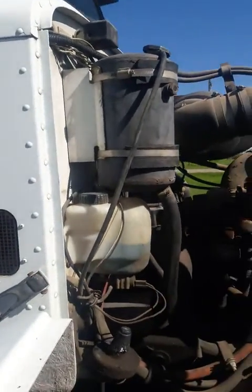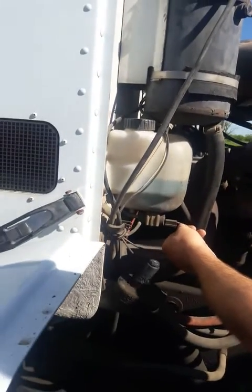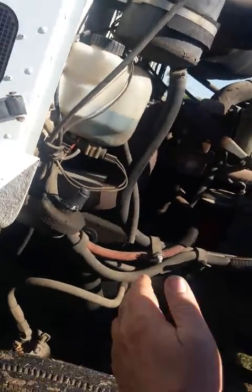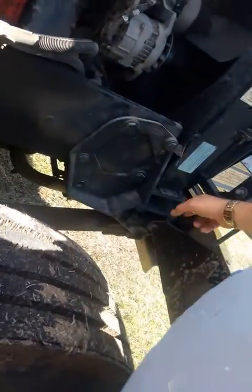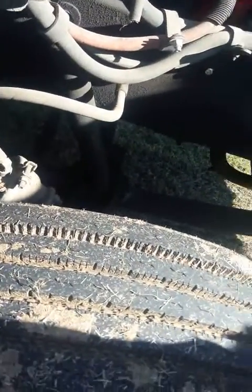All right. Check all your wiring. Make sure the wire's all properly connected, no bare broken wires. Check your frame, 3 foot of frame, cracks, broken welds, missing or broken bolts. Check your spring hangers, missing, broken bolts, cracks, no visual defects. What do your spring hangers do? They hold your springs. Check for cracked, broken, or misaligned springs.